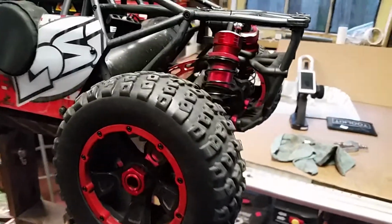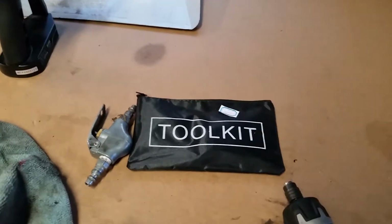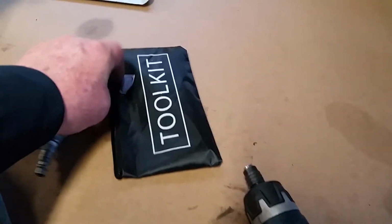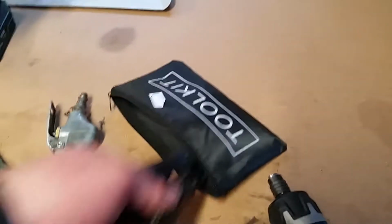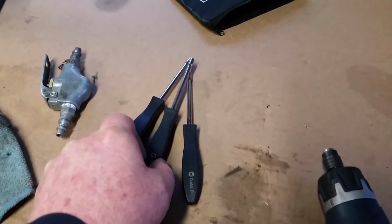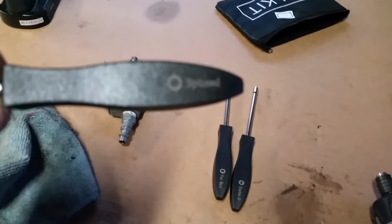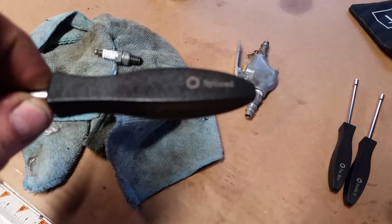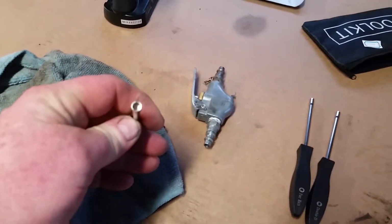Now, that's not all I've done today. You can see the radio. Now, when you're working on weed eaters, you need special tools, believe it or not, for the carburetor. To adjust the carburetor for these weed whackers, so far I only got 3 different kinds of mixture screw heads here. So we're going to pick up this one right here. Let me get it in focus. Yeah, this is the splined. You can't read it very well, but this is splined, which is what it looks like.